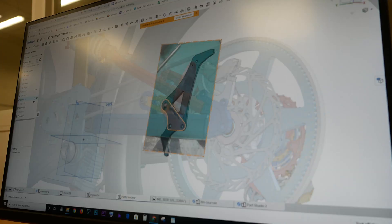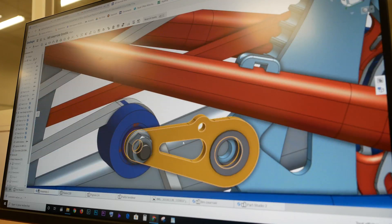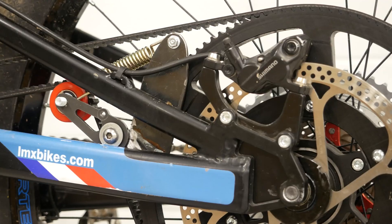The first main goal for this project was to make it fully compatible with any LMX64 or LMX81 that we sold. The main issue is that with a belt you cannot open it to thread it inside the swing arm. So we had to find a way that both strands of the belt were going inside the swing arm. What we found is that by positioning the tensioner at the right position, we could achieve that.